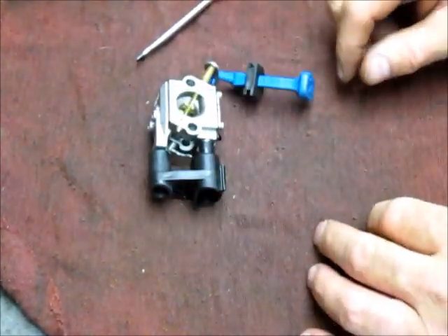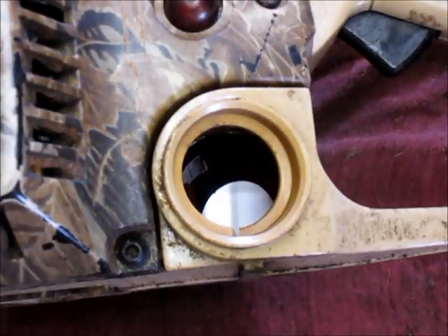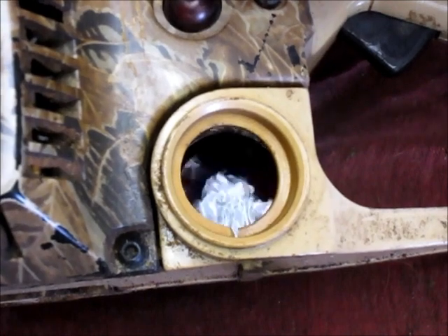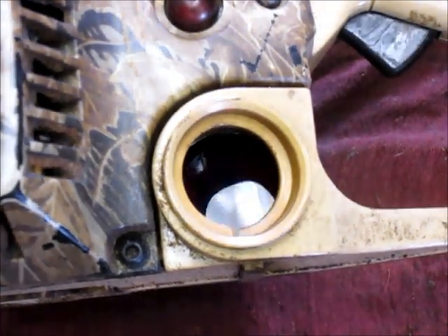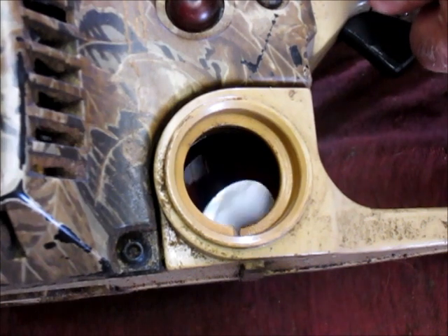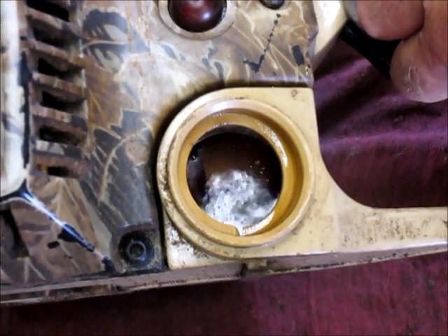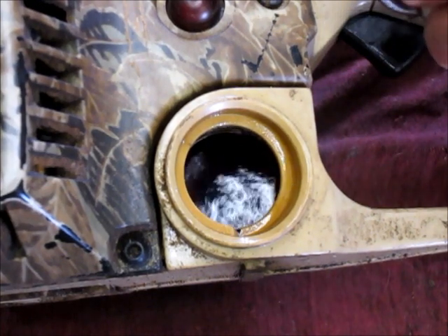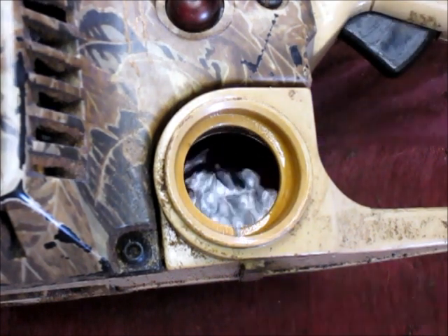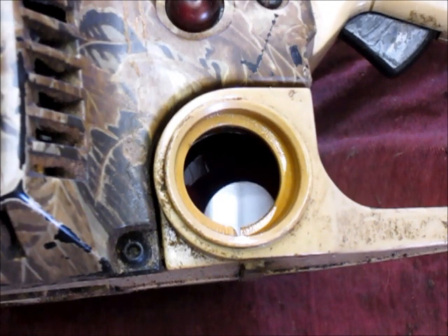Like I said, we'll put some gas in the gas tank and blow some compressed air through the line and see what happens. I'm pretty sure the fuel lines are still good — there's gas dripping out of one here because it's lower than the fuel level. Let's put a little air in and watch for bubbles right in here. Yeah, I think we're good there — the fuel lines seem okay and it's moving fuel.